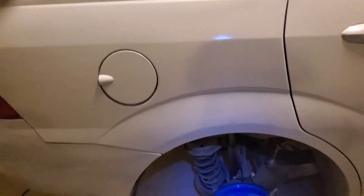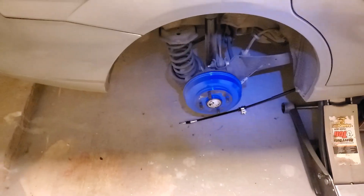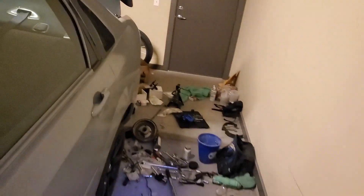I'm going to take you over to the driver's side real quick and show you what I've done to help with the brake fluid not getting everywhere. I use a pole to press down on the brake pedal so that it will stop the flow of the brake fluid moving to the lines, so I can work and I don't have to clamp anything. Pretty cool, huh? I thought so too. All right, let's get back to the other part.